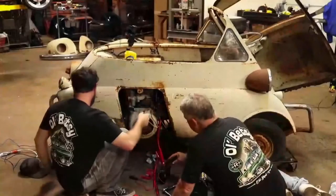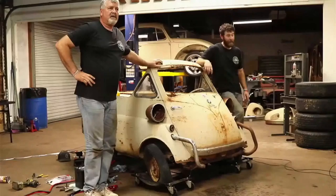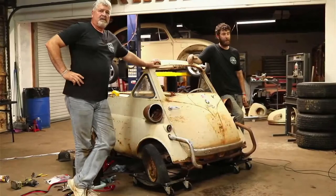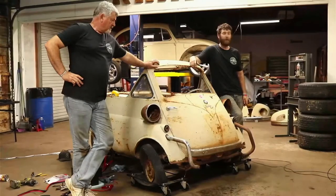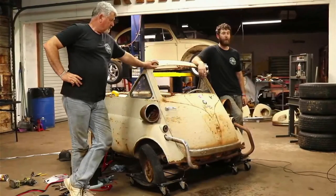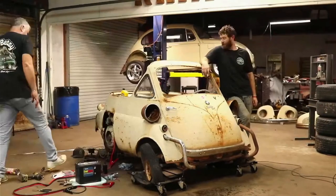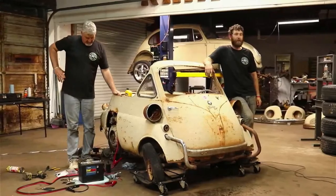I'm gonna try to adjust some points a little bit more, and then we're gonna have to call it good if that don't work. And I don't know, we've tried a different coil. It should be sparking down there, but it's just not for some reason. We'll probably come up here tomorrow and tinker with it, and it'll start sparking like we needed to, probably. So maybe she's just a little camera shy. If I remember, it's all in God's timing. Yep. It just wasn't meant to be tonight.